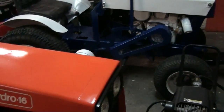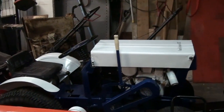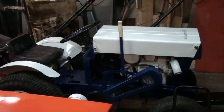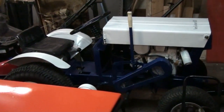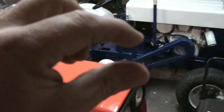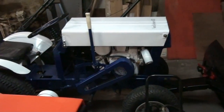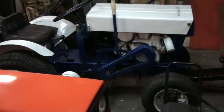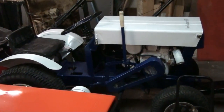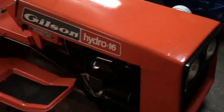It was sketchy as all get out, but you know what? It worked, because I didn't have time to go get a tensioner wrench. I guess it would fit in there because it's basically just a flat piece of metal with the 3/8 square piece on the end. So, anyway, if you own an HHR, you might want to invest in one of those tools. Get a cheap Harbor Freight one. You'll have to cut it down because they're too long, but you'll want it. Trust me, you'll want it. So, okay.